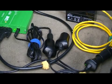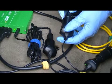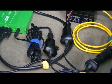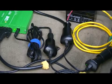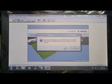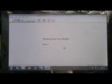Once again, I have the software ready to go with case comments and I am ready to collect data. I am going to plug my repowering rig into my Y adapter — remember, power last — and then click the collect ACM data icon. I answer the Ford privacy question. The software will go through the standard three passes and then I can save the collected data. Ultimately, using the repowering rig and an external source of power, I will have successfully collected data bypassing the vehicle's electrical system and without the necessity of the ignition key.